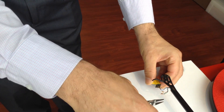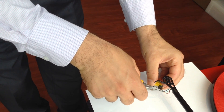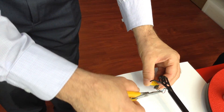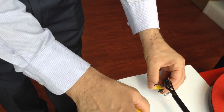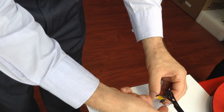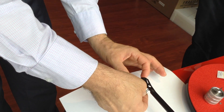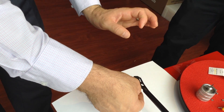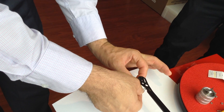And then we'll do the red and the green — doesn't matter in what order. And red. As you can see, the wires are still all out of the way. Now to attach it, you've got to be a little bit careful that you don't touch the cantilever or the stylus. Hold it by the sides.